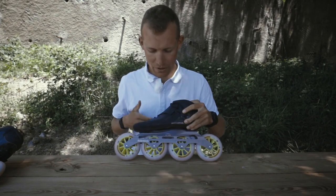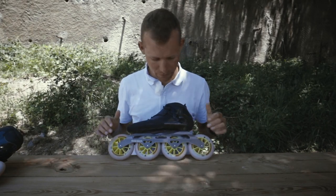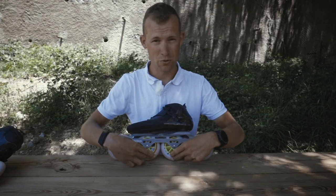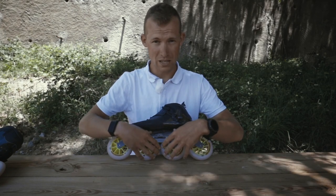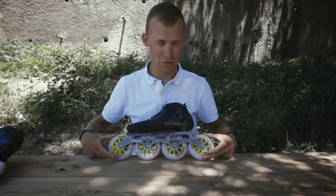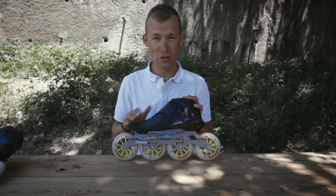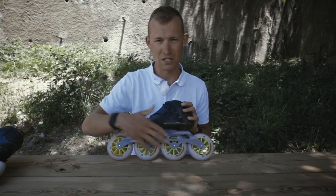Just to sum up quickly: first, we have our wheels brand new. After using them for a while, we take the outer wheels and put them in the center. After a while we flip all the wheels, keep them there for a bit, and once they're flipped we keep them flipped and take the center wheels back to the front and rear positions again. This way you're going to have the same amount of pressure over time and the same amount of exposure to each side and each position of all the wheels.